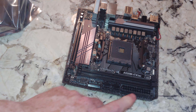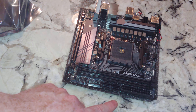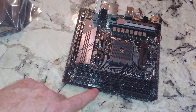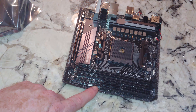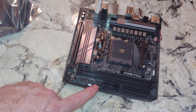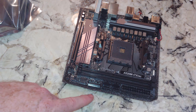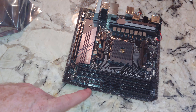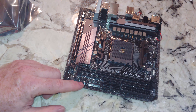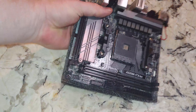This is going to come from your power supply — this is the 24-pin connector here from the PSU. You've got four SATA 3 connectors here for data. This is the USB 3.0 header that comes from your case. Sometimes cases don't have these, so that's always a possibility — you may just have USB 2.0. Sometimes you'll have two USB 3.0s, but this motherboard doesn't support more than one.